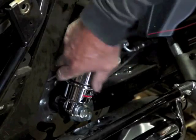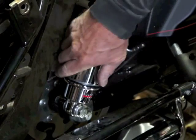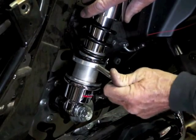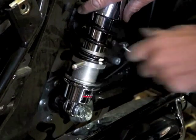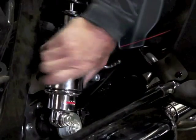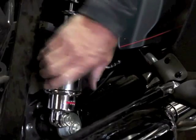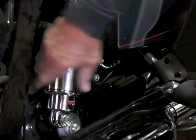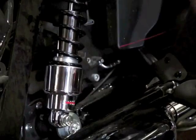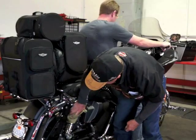The bottom spring cover is where your spring adjuster is — twist that off. I should have mentioned to begin with that the shock shaft goes to the top of the frame generally, and the body goes to the swinging arm. I'm showing you adjusting that a quarter of a turn. To get a hundred thousandths worth of adjustment up or down, you have to turn it probably five half-turns. So usually I'm adjusting it at ten, twelve, fifteen turns.